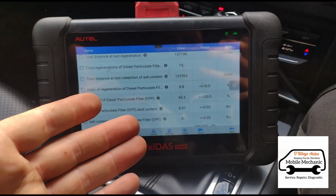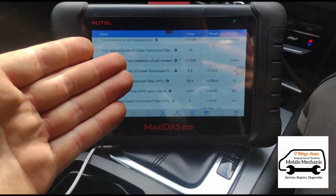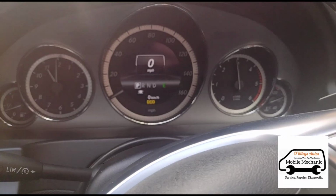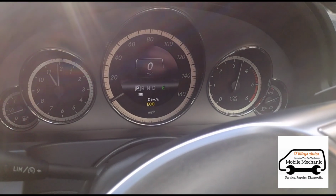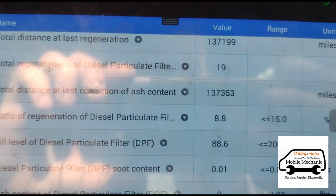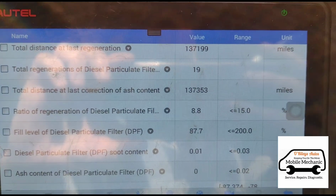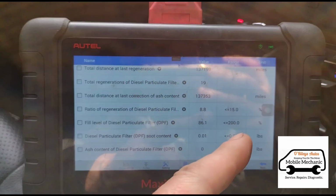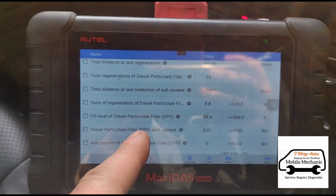Now that the boost pipes are on, you're getting boost pressure, which is cleaning the DPF, pushing it out. We're just holding it on some revs, anywhere between 3,000 to 3,500. Just holding the revs there, and we'll just see that rapidly decreasing there. It's nice to see the live data when everything's working properly, that this just suddenly rapidly decreases.